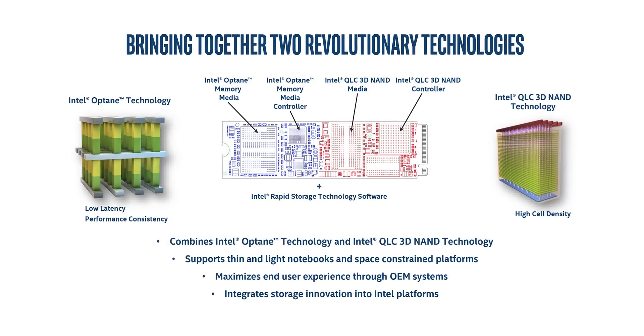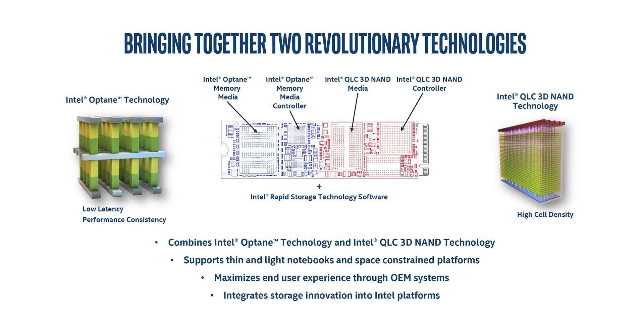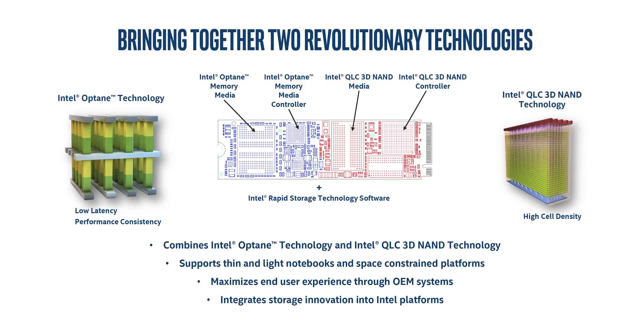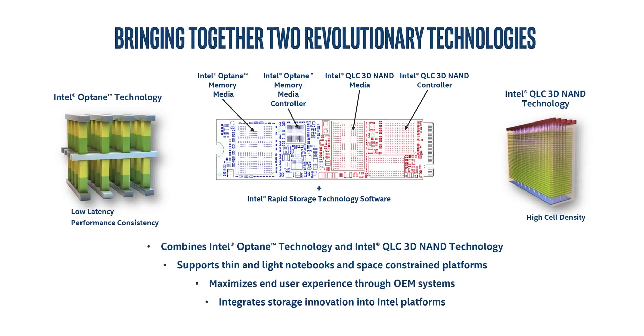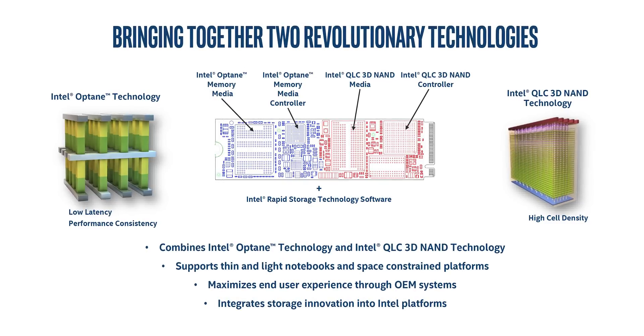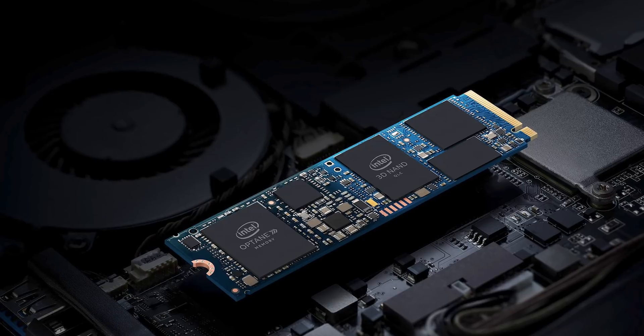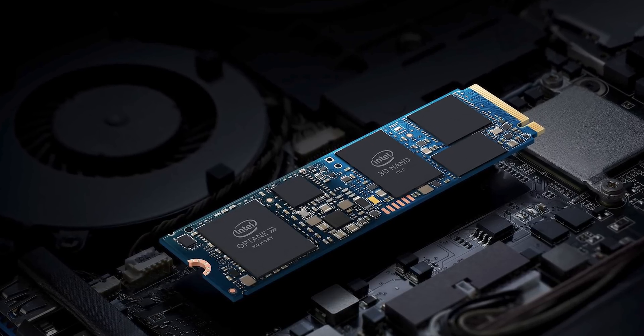In the past, Optane did not have enough performance to properly accelerate SSDs, but with technological improvements, we can now take this SSD section and accelerate it with Optane by supposedly a pretty big amount. This communicates with the system via the X4 NVMe interface, which reserves two lanes for the NAND and the other two for Optane caching. With Intel Smart Response driver working in the background to cache your most used files and dynamically accelerate them, this is all supposed to happen without any interaction from the user. Having a single module with Optane memory and the SSD it's accelerating is exciting because you're basically miniaturizing your primary storage and the Optane memory acceleration.